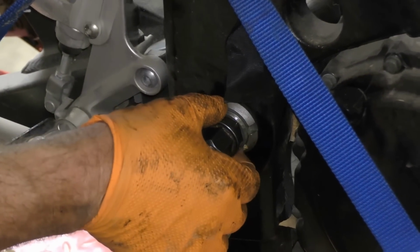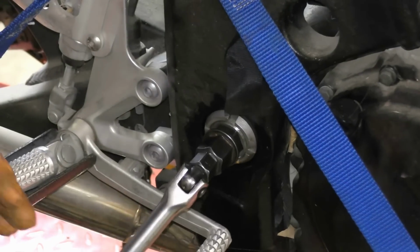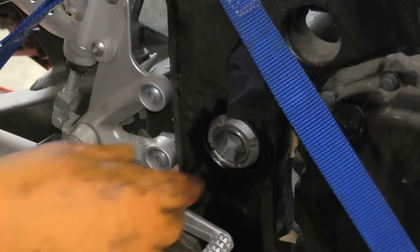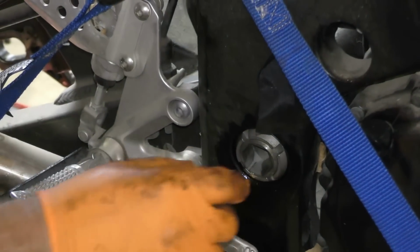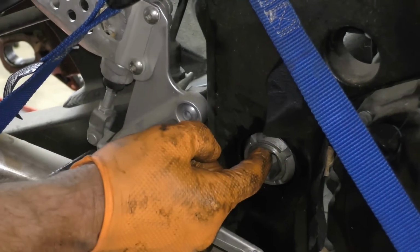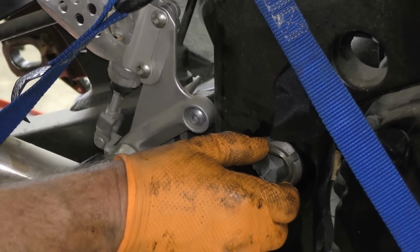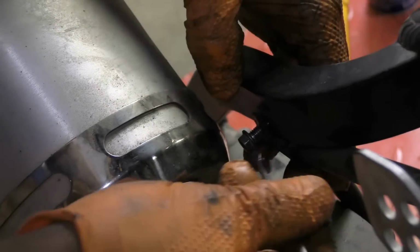Fastened back up. And this was just funny because with the soaking of the oil, it actually started moving. So we'll move it back. No. Set your swing arm tight, and then you torque it to the specific value. And then you come in with a castle nut tool, and this gets screwed in. Now there's an associated torque value with this, which is very low. This becomes a friction fit between the frame and this. So if the nut falls off the other side, you have a little bit of redundancy here in not letting the swing arm pivot bolt unscrew itself. No. Wow. That's all wrong, Dave.